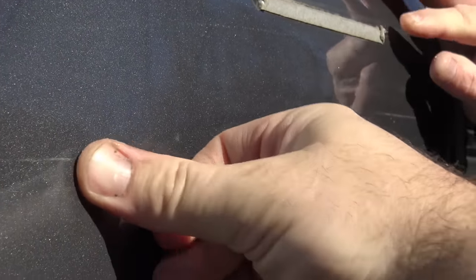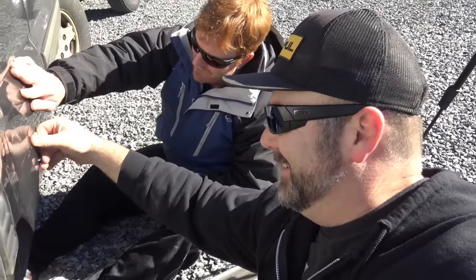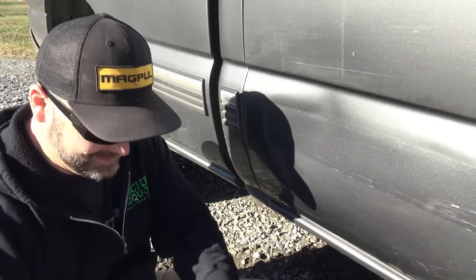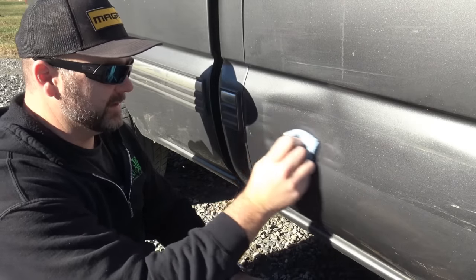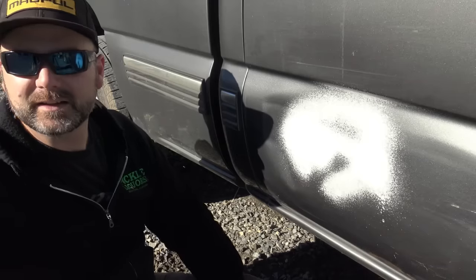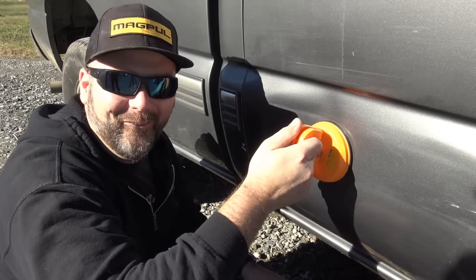That's the texture of a booger! How many windows in your truck roll down? In theory, two. I keep trying to get Red Beaver up here so we can replace the window regulators on his truck. This is his rock star pickup truck. Alright, we got the trim off. We're gonna take a little bit of Goof Off and clean this adhesive off. I hope this works — this is gonna be really cool if it does. Let me get all our adhesive pieces off of here. Once the adhesive is removed from the spot where we're gonna work, we'll go ahead and clean it one more time with some glass cleaner.